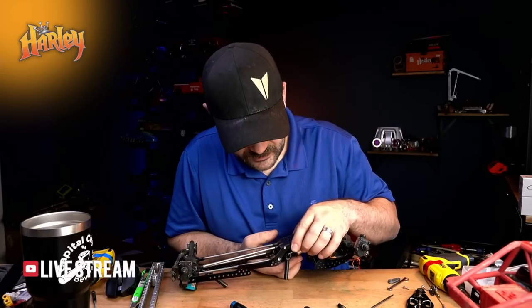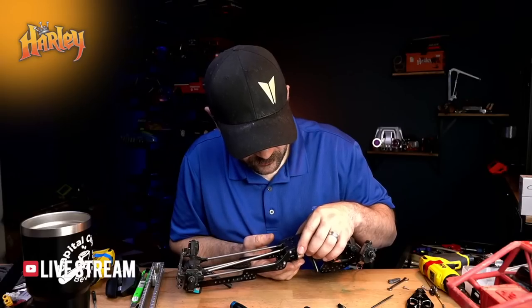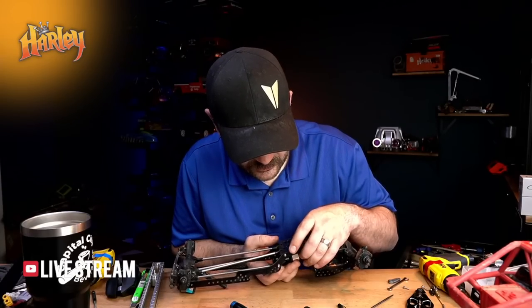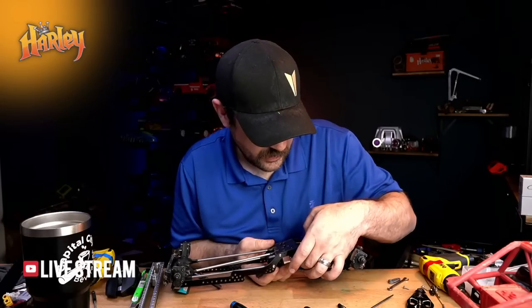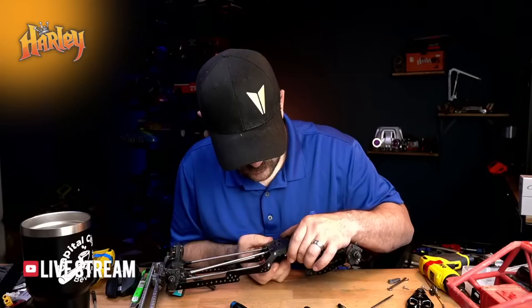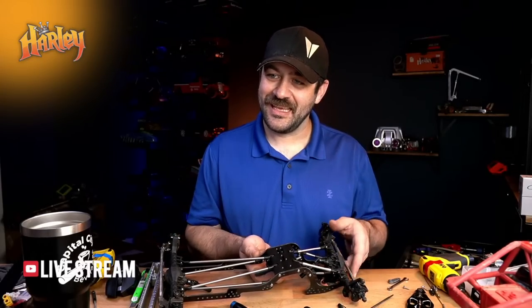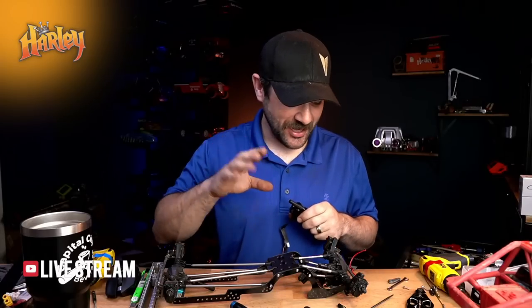Trying to figure out how to put this transmission in here. I know I'll need a spacer under it. It usually comes with one and I think I've lost it somewhere by now, but that position hits the link screw. That one is too steep for the front. I feel like that one, I need slightly shorter uppers so that I don't hit the rod end up there. Joy. We're not doing it now.